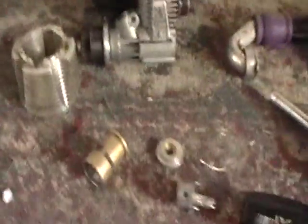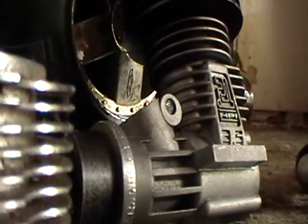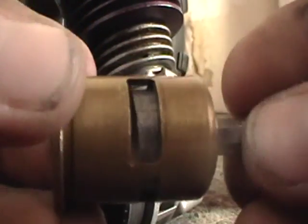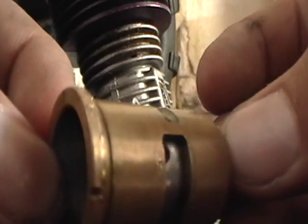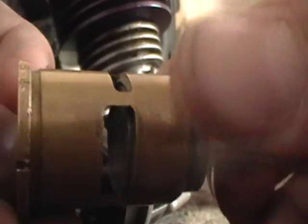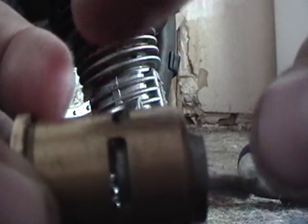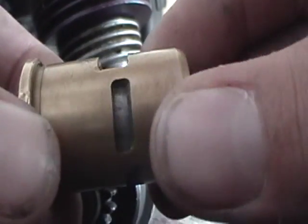Basically the crankshaft and the piston is your valve. You've got your piston going up and down in here. It's compressed, it's ignited, keeps going up a little bit, now it's traveling downward. The exhaust gas comes out, and the pressure from the crankcase pushes the fuel-air mixture in through these holes. There's two boost ports and two normal ports.